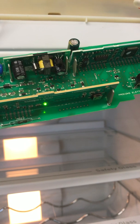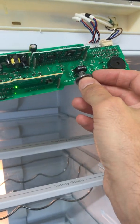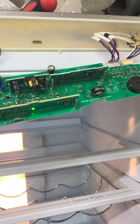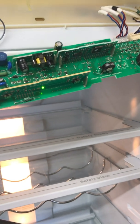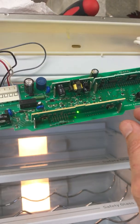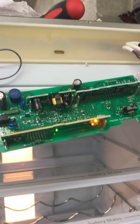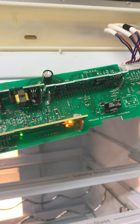The starting sequence then tells you to turn the freezer to the halfway point. The other fridge is what's making all the noise — it's not this one that's running. Put the freezer to the halfway point, give it a couple of seconds, then press the super freeze button. Be very careful touching this PCB because there is mains voltage in it. Now the evaporator fans have kicked in, the super freeze light has gone on, and the unit's now behaving itself.